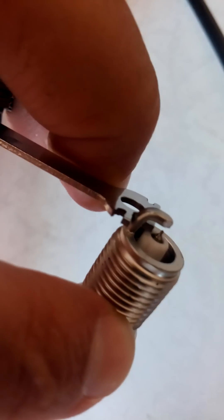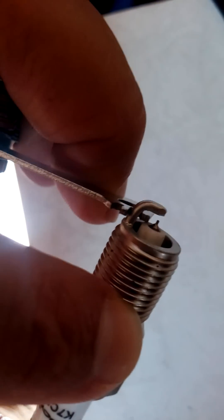Basically, you have to get the opening wrapped around the electrode — like this. You've got that electrode wrapped around that slot, and now by pushing down you can cause that electrode to start moving up. This is how you actually get the electrode to open up without having to put force on that center electrode.